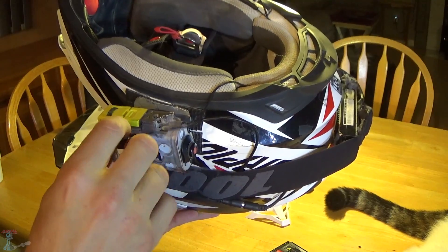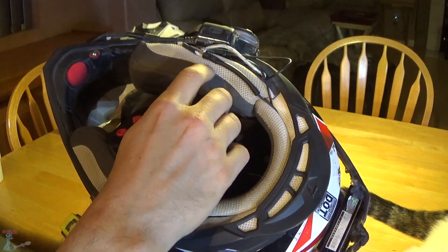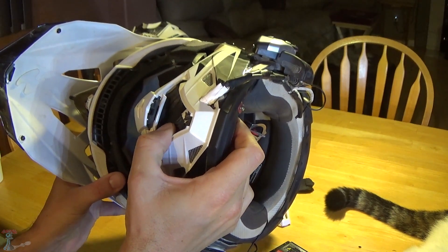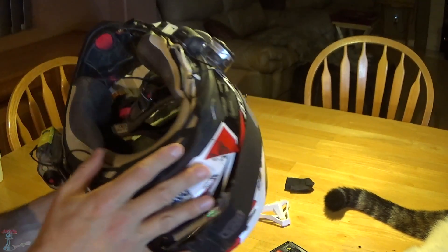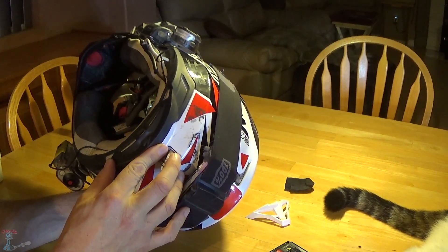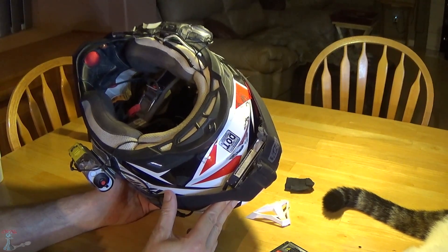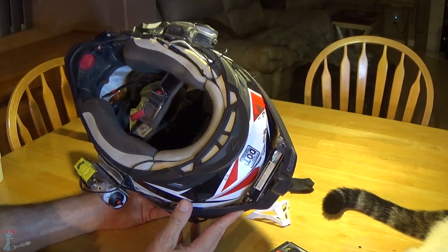The way the microphone is run is it comes out of the camera, comes around, and right here is where it separates — one channel goes to the speaker inside the helmet, and the other channel goes next to the microphone for the Senna. So basically I have two microphones in the Senna area: one for the Senna and one for the camera. I thought about using the Senna audio backpack, but then you've got to power that, and the battery can't last as long. You might only get two or three hours of audio. I thought this solution is simpler, it's cleaner, and you don't have another device you've got to try to pair and get working.